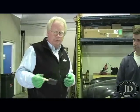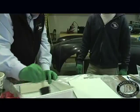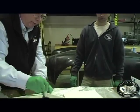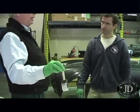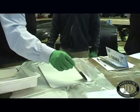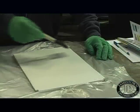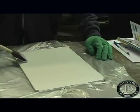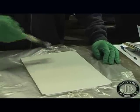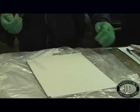Roll out that whole surface — nothing wrong with putting a little pressure on there — and just make sure you get an even thickness of paint over the entire surface. Now we're going to tip it off. The technique for tipping off: you want to get the brush wet with product, but the brush itself does not add paint to the job. We want it wet enough that it will glide on the surface — we don't push it into the paint. It's just almost falling out of your fingertips. Very gently, in the opposite direction of the way we rolled, tip off those bubbles. You let it set up overnight, come back the next day, take a Scotch-Brite pad, and get rid of the gloss in the first coat. We like the Scotch-Brite because it won't burn through the product — sandpaper is just too aggressive. Just let the product do its job. That's the technique.